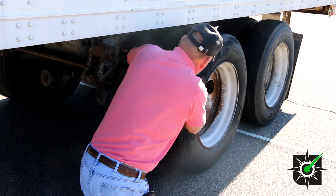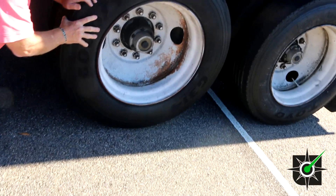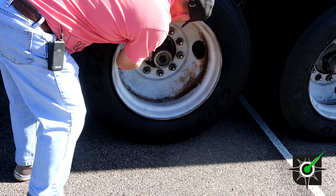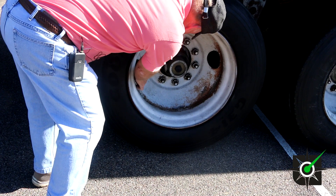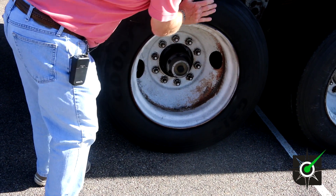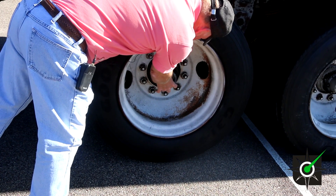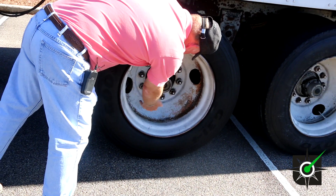The wheel — once again, there's no cracks in it, no illegal welds, properly mounted and secure. The bolts are all present and tight — the lugs, if they were loose, there'd be rust trails on the wheel and shiny threads. The wheel has a valve stem — bolted on tight with a cap, pumped to 100 pounds of pressure, and we check it with a gauge. We have the hub seal — you can see this one better, it's clear, you can see the fluid inside. All the bolts are present and tight, and it's not leaking.